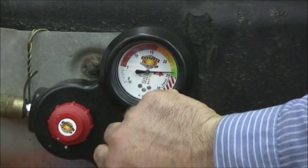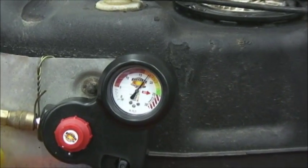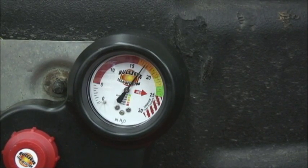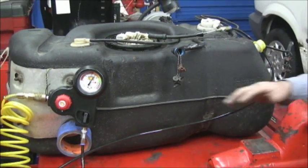Now I'm going to turn this lever and see where our leak is. There's our leak, and our leak is in the orange, almost into the red. That's not good. So now we have to be able to find this leak. And this is not a made-up leak — this is actually a problem on this vehicle. If you check Jeep Liberties, they have problems with porous tanks.